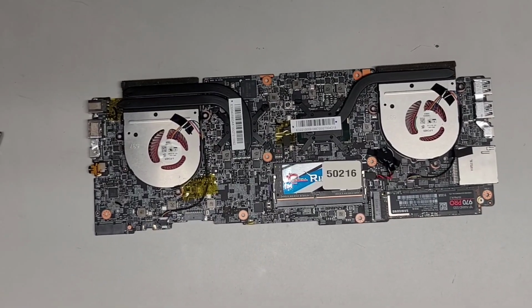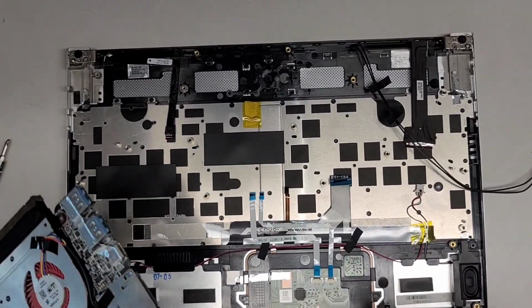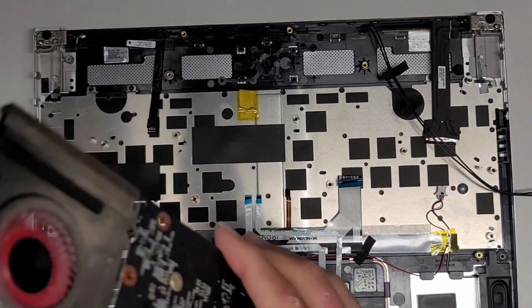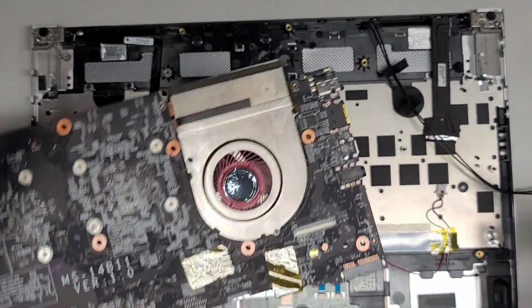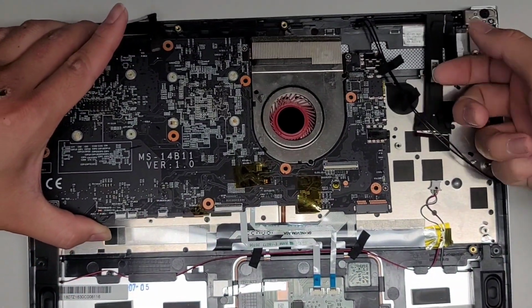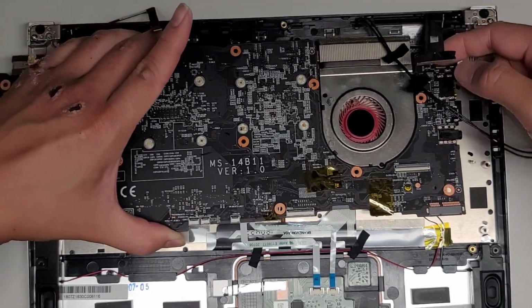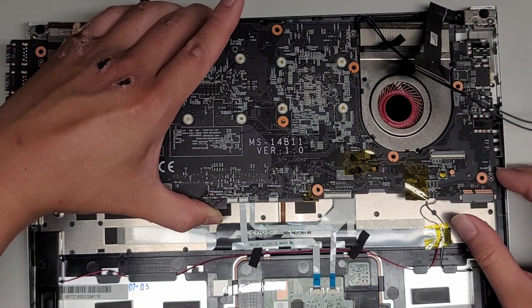We'll now get the laptop back here. Okay. And just like before when we took it out, now we have to put it back at the angle like that so that this headphone jack can go in properly. All right. You want to make sure all these cables are out of the way. Okay, so make sure, lift them all up, make sure they end up on top of the motherboard, not underneath. Okay, so there's three cables at the top edge here.